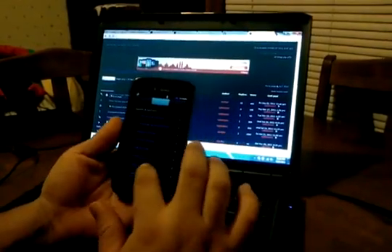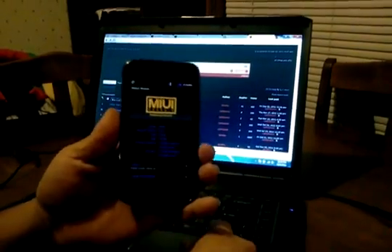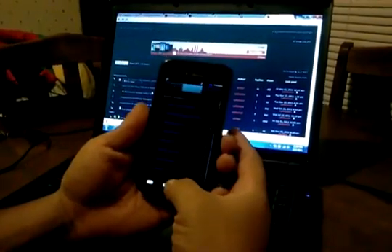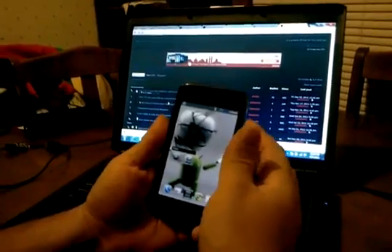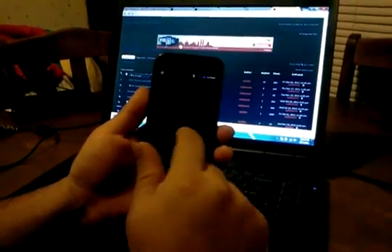Go to Settings, then System, and I'll show you what version of Android it is. The phone's a little non-responsive because it's still booting up. Go to About Phone — and there we go. That's Android 2.3.7. If you hold the Power button down, you'll get the reboot options. Just hit Reboot, click on Recovery, and OK. That's going to take us back into Clockwork.